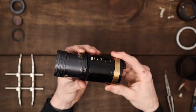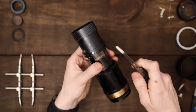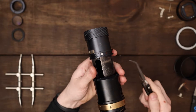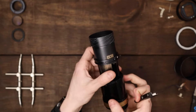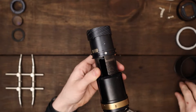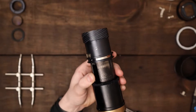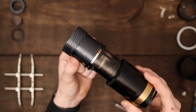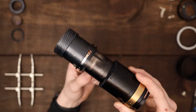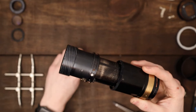And that's one of the strange design choices about this. The other one is how this barrel is centered over this barrel. This lens utilizes three little Teflon inserts around the barrel — two of them are already removed — that are all being pressed down by little spring bars. And that is how this barrel is centered over this barrel. I've never seen a design like that before, not with any of the Nikons I've disassembled at least.